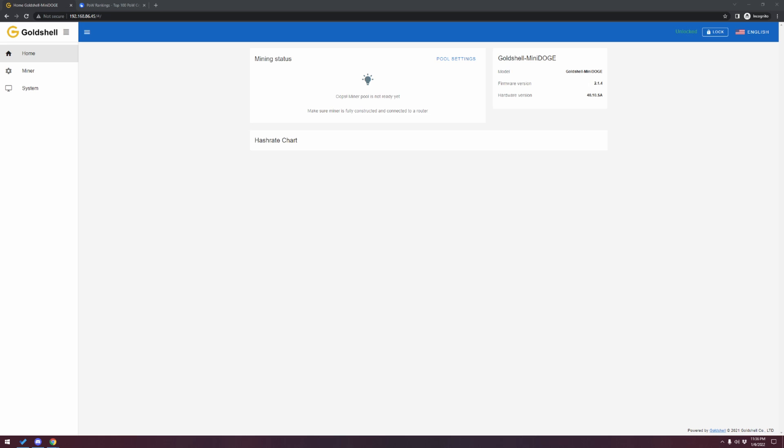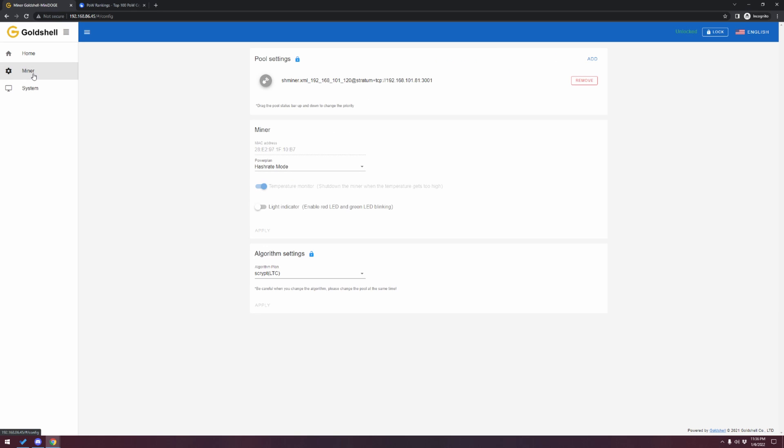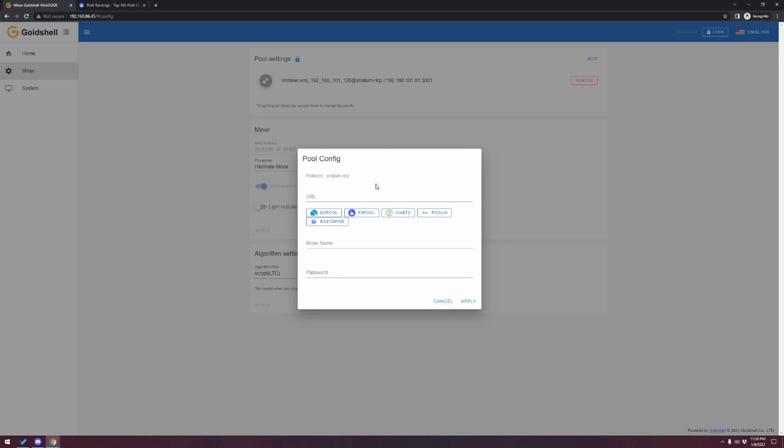Back at the home screen — click Home in the upper left. The next step is to set up your miner because it is not mining to your pool or your address right now — it's actually mining to someone else's, most likely Gold Shell's. On the left side, select Miner, then go ahead and change the pool to what you want to mine to. Up at the top you can see this is not our miner information at all, so we click Add. We have to select a pool — the pool provides the jobs and work for your miner, which then the pool pays out to your wallet. We're going to select F2 Pool for this example.